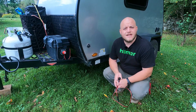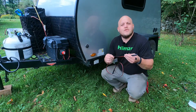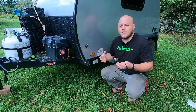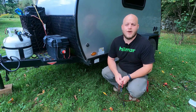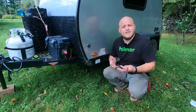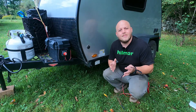We would probably use a better connector and 10-gauge wire, pure copper, something high quality, so we can use a wide range of different solar products. These are typically 12-gauge wire with really cheap components. For that reason, although it's easy to use, it's not the best solution.